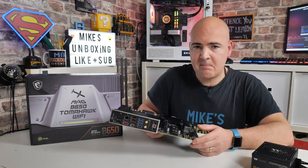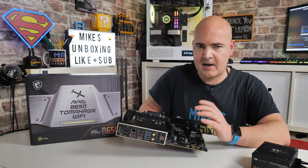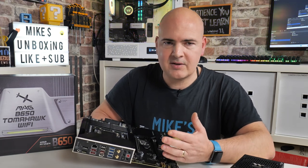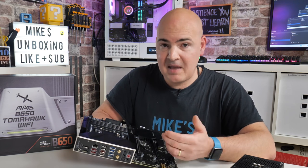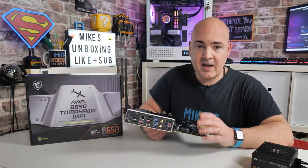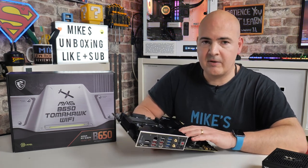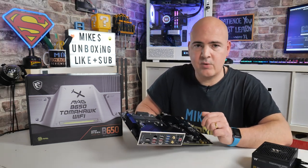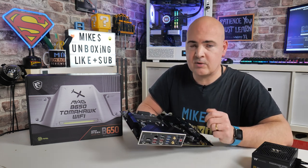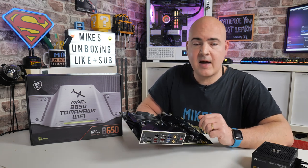In this video we're going to show you how to perform a USB BIOS flashback. This isn't entirely necessary for a lot of AM5 users, especially as of January 2023, but as new processors come out — no doubt there'll be an 8000 series and processors with integrated graphics — there's a strong chance you may want to pick up one of these boards at a bargain price and flash the BIOS to support the latest processors. AMD have also released a new AGESA code, version 1.0.0.4, which introduces support for non-X processors and X3D processors from the AM5 platform.